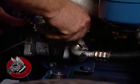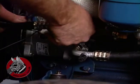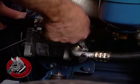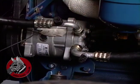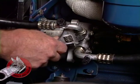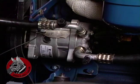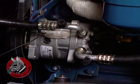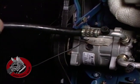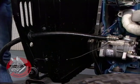Start our nut here. Once again, you don't want to tighten these too tight because you'll just deform the O-ring. We'll just cinch it up here. That'll do it. This is our high pressure hose that takes the vaporized refrigerant over to the condenser over here where it's turned back into a liquid.